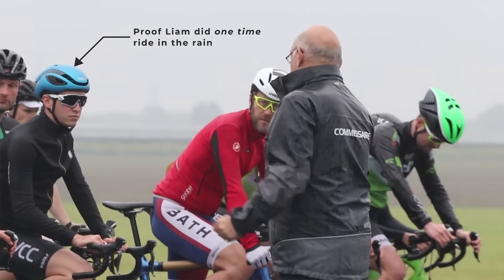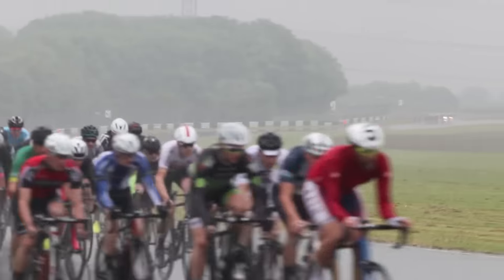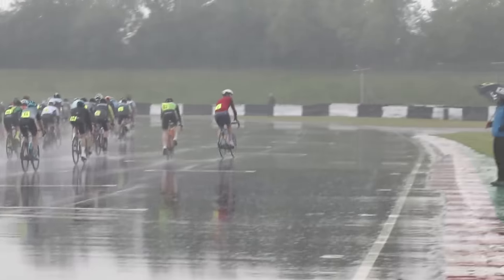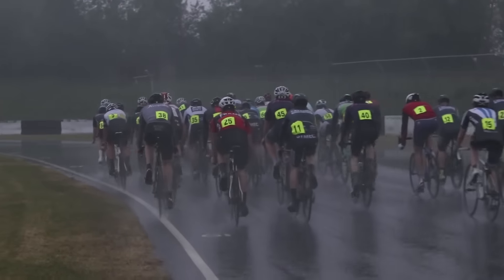It's definitely noticeable that rim brakes don't work so well in wet conditions. Water on the road quickly gets transferred to your wheel rims while you're riding, and water on any braking surface reduces friction and affects performance. The coefficient of friction with normal brake pads and an aluminium braking surface doesn't drop as radically as it does with steel, but it is still significant. Disc brakes are affected by wet conditions too, albeit not as badly — they're fixed down at your hubs, so disc brake rotors are further from the road surface and don't get covered in as much spray or mud.